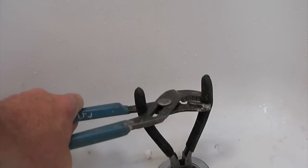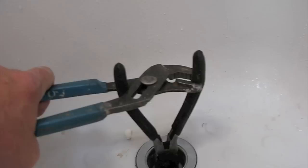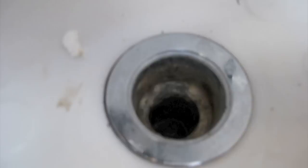Hopefully your RV has easy access to get to the plumbing. That's the faucet there for the tub, and any drains we may need to access are underneath. I saw this nifty trick for removing a tub drain — you basically insert some needle-nose pliers and grab them with an adjustable wrench and turn. But that doesn't always work; it just breaks off the bars that you force the turning against. So we're gonna have to remove this drain from the plumbing in behind.